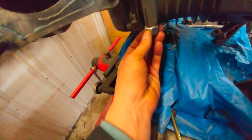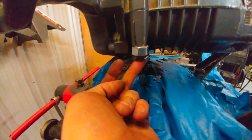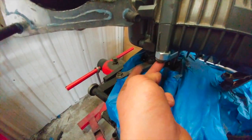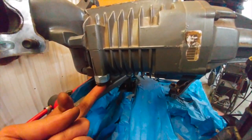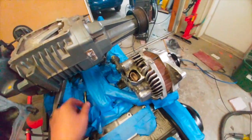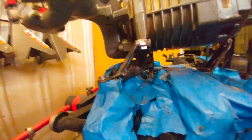After that, the next step is I've got another one of these bolts — this is what I've been making the brackets out of. I've been putting a bolt through it like that so I have a mounting surface, then taking the angle iron — a piece from here down to here. There's probably going to be one that comes down this way and then another one that goes that way so that it's triangulated, and depending on space I might throw one more in somewhere else. I'm definitely going to have to tie into this alternator ear somewhere. I've gotten a little bit further since last night — we were working on this mount right here where we left off.